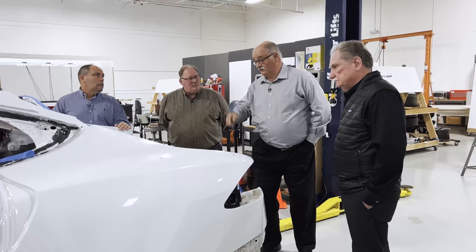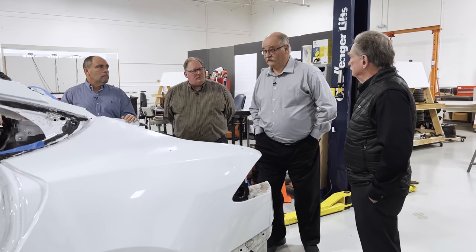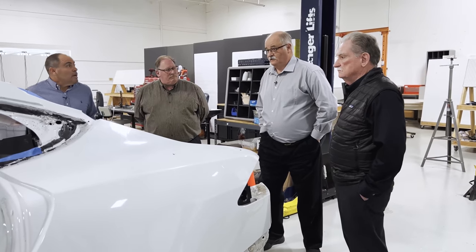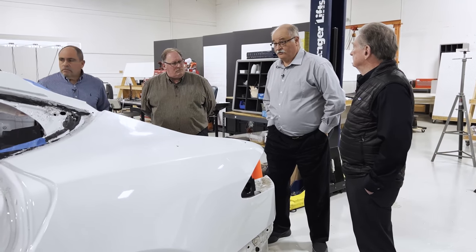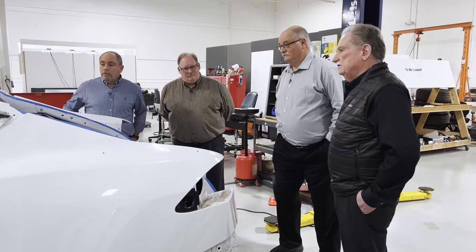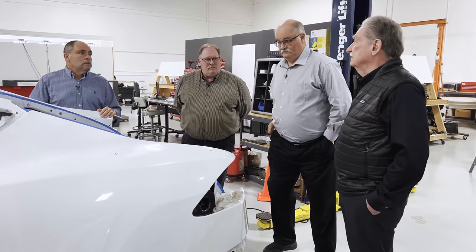The body controllers left and right act as pass-throughs for a lot of circuits — even some CAN circuits just come in and get distributed around, without a dedicated CAN transceiver for a couple of buses. Audio circuits to the doors, airbag circuits — Tesla's not been afraid to use another controller to route those circuits through it. Historically that's just demarcation between 'that's mine and that's yours,' but what it does for you is eliminate large inline connectors between harnesses.